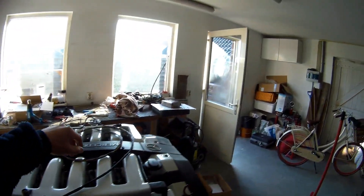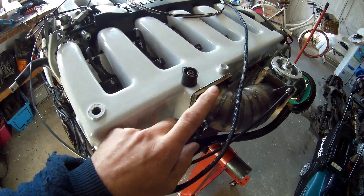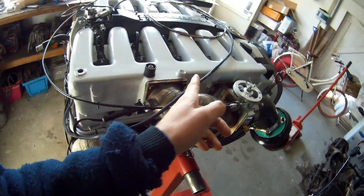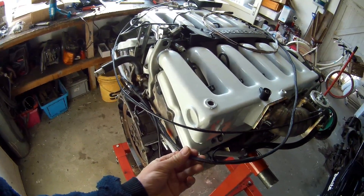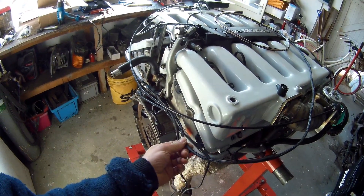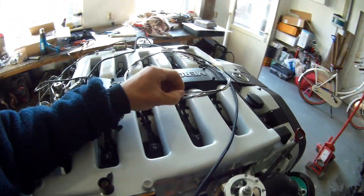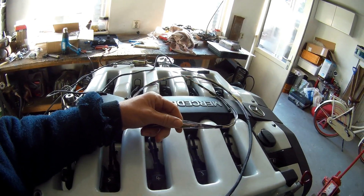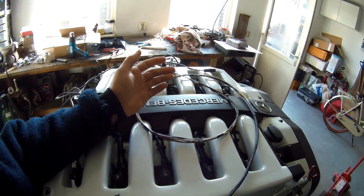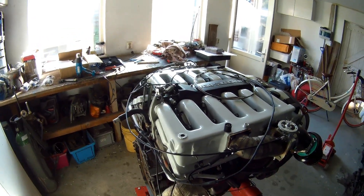The intake air temperature sensor is connected, with wires going into the loom. I really like to use this kind of sleeve — it's pretty temperature resistant. I use automotive wires, most of them 0.5 millimeters, with different wire types for different sensors. Every sensor has its own ground going back to the ECU — that's the best approach.